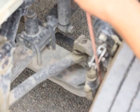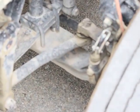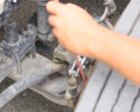My brake shoes are properly mounted and secured. They're not bent, broken, or damaged. Not missing any bolts, nuts, or hardware. And not worn dangerously thin. My brake drum is properly mounted and secured. It's not bent, broken, or damaged. There's no cracks, no illegal welds, no oil or grease that could start a fire.